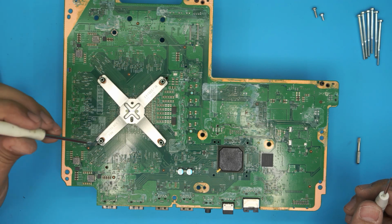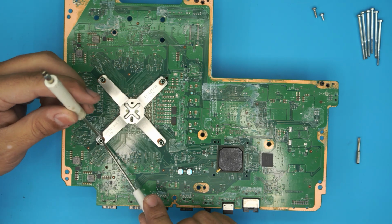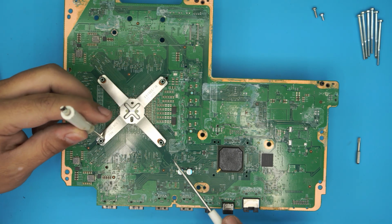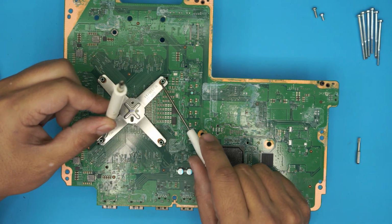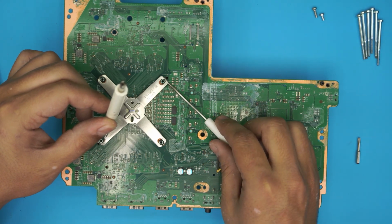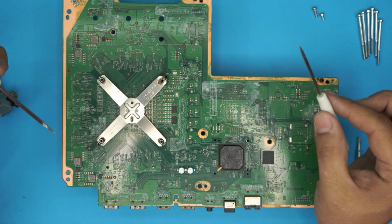The proper way is to put the screwdriver right in here between the screw head and where the screw goes, in the little gap that they have in here. And you want to apply a little bit of force, pushing it this way, so you actually push this one towards the other one. And you want to grab the flat one, stick it between the back and the front one. And there we have it, with no force at all.